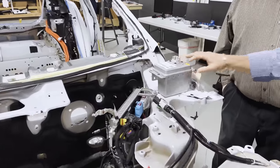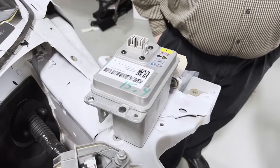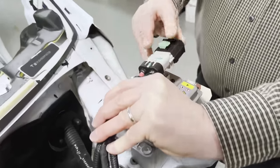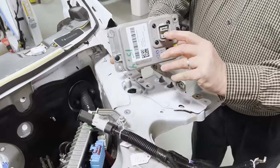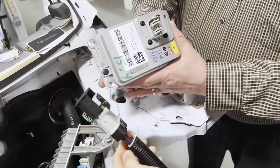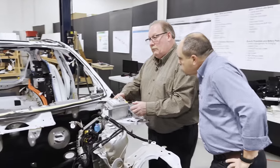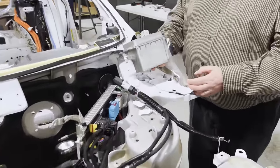The lead-acid battery is gone and we've got a small lithium-ion battery. It connects up to the battery front controller, and instead of conventional studs, it has a five-way connector. There's a LIN circuit in it that talks back to the battery controller, plus a ground and probably another battery circuit to feed the electronics. According to Ben, that saves about 10 kilograms compared to the lead-acid.